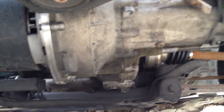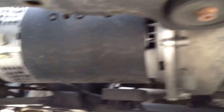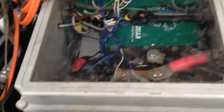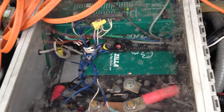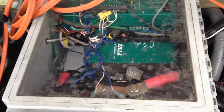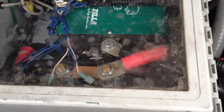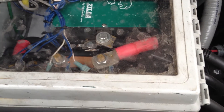This is the original manual transmission. Probably the interesting thing about this is there's no clutch, because you don't really need a clutch on a car like this. The motor doesn't have a lot of inertia like a regular engine would, so the synchros will automatically spin the motor to the right speed to enable shifting. Here is the main controller — this is a Zilla controller. It's been on the market for quite a while, but it's really dedicated primarily to the do-it-yourself market. Main power comes in over here, and it's IGBT-based electronics, pulse-width modulating DC down to the motor.